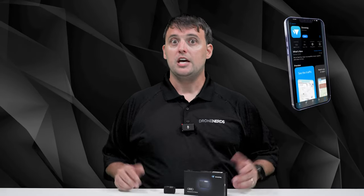Let's talk about the app. If you prefer not to use any app, you're not obligated to. The DroneTag device functions and covers compliance with FAA rules seamlessly without an application — simply upload the serial number to the FAA drone zone, turn on the device, and wait until it flashes white and you can fly. For enhanced functionality, including device status and data monitoring and firmware updates, you can download and utilize the DroneTag app.